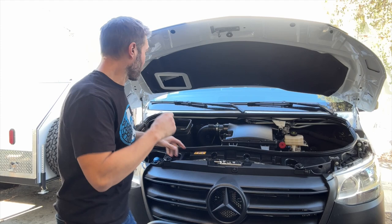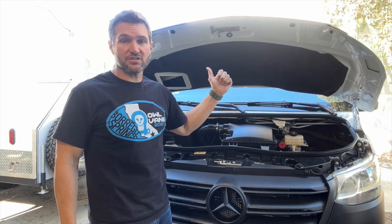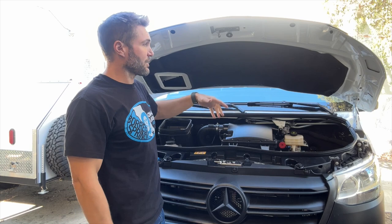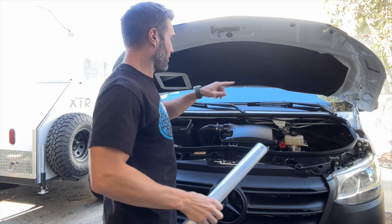We made it out to the vehicle, we are ready to get started. The hood on this van is already open, and that's one of the things we have to get rid of. We're going to go ahead and put the gas strut on the far side first and just leave that to hold the hood open. The single-sided strut actually isn't going to hold this up, so we're going to have to prop it with something. I just used a piece of aluminum I had laying around — you really can use anything you want.